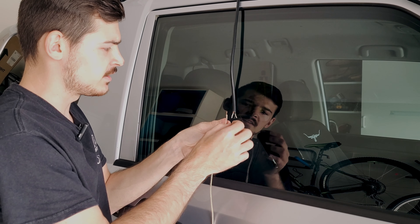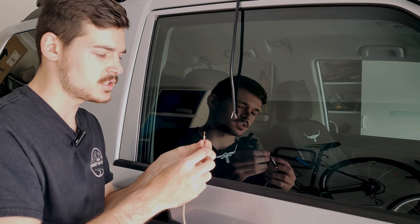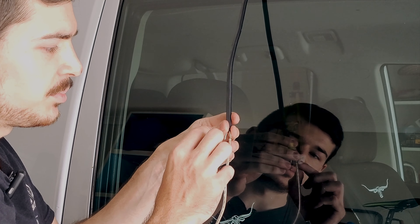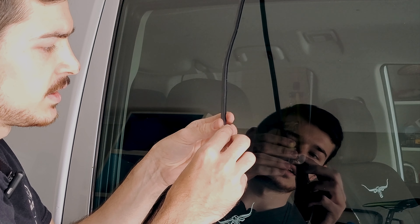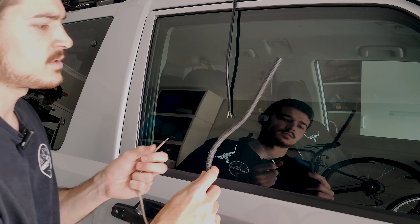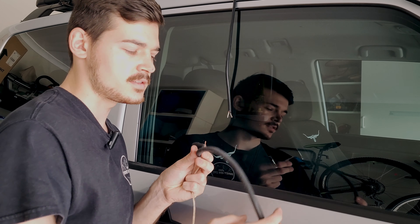Once you've chopped it off, just make sure to make it nice and clean, grab about the same size wire and make sure it's long enough to reach your engine bay. All you've got to do is solder that on, then put a bit of heat shrink on it, and after that cover it with black tubing so it goes into the wiring concealer.